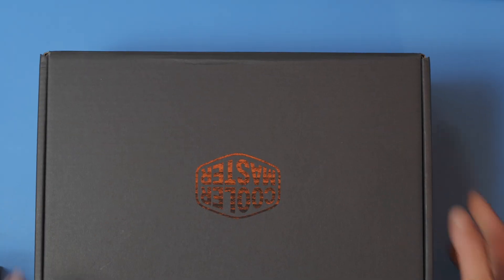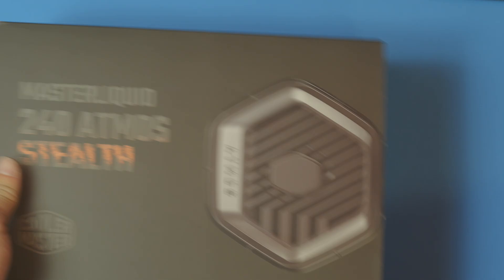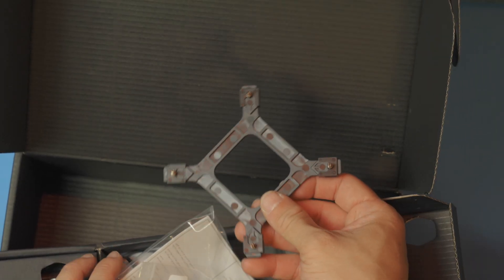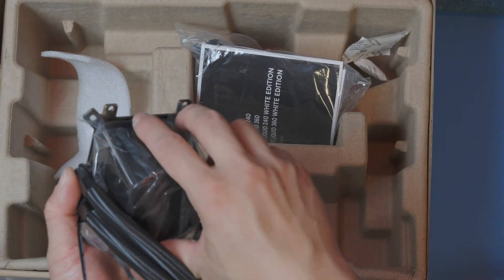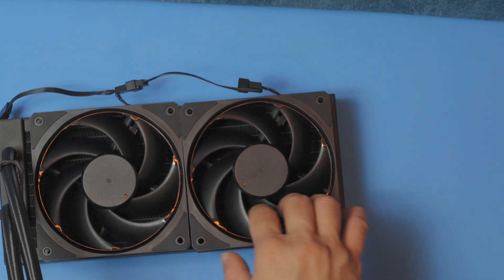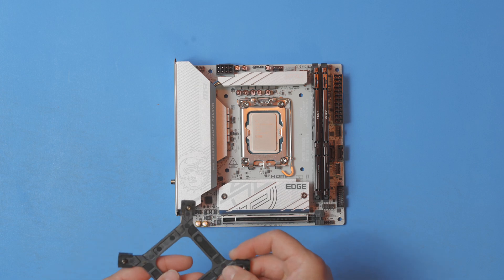To cool the CPU, we will go with a 240 AIO. I have two options depending on your budget. I reviewed this unit and we will need to grab the Intel back plate. If your budget is a little more tight, you can also consider this one from the same company — the Elite 240, a sub-brand of Cooler Master. It's also a good choice because the pump block height is low enough to clear in the case. With the Atmos stealth unit, you won't need to upgrade the fans. These Mobius fans are very high quality, you'll get good temps, and there are a lot of user-friendly features.